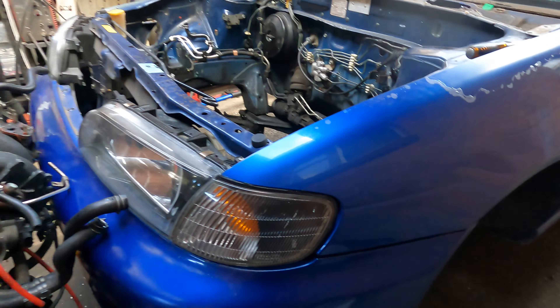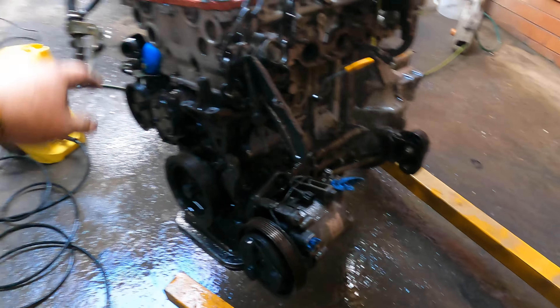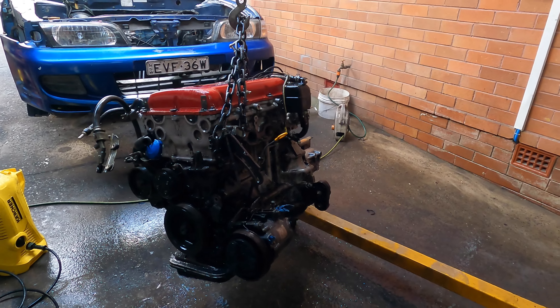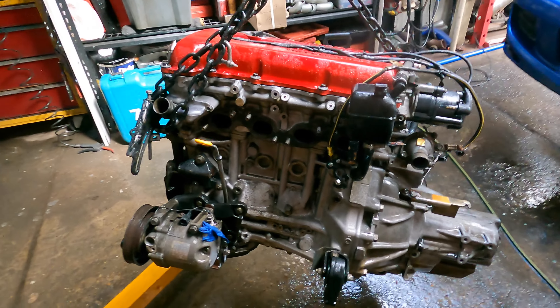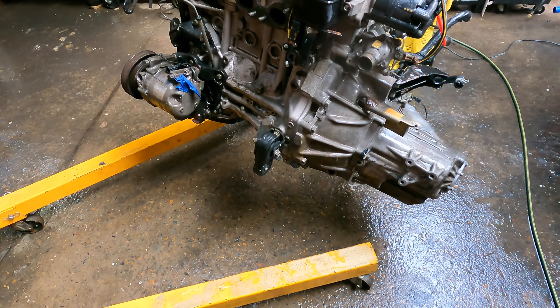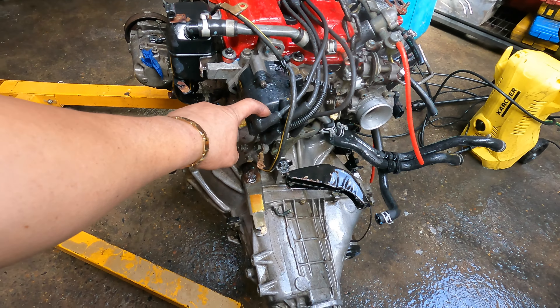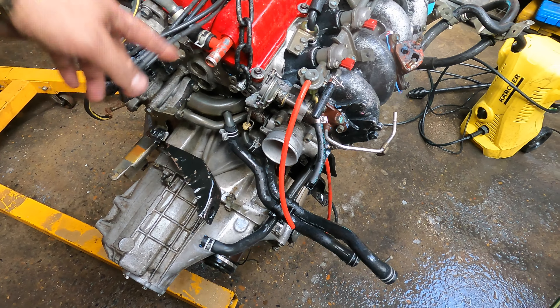Spray the degreaser on and then wash all the dirty grease off with the water jet. Before we strip the engine make sure it's nice and clean so we don't have too much dust or dirt on your hands. We'll leave it for the next day and strip it out. We'll order the gasket packs, make sure we take measurements and order the correct size of bearings and rings - just in case we buy the wrong ones. Maybe inside the engine it's been rebuilt or different size overbore - who knows. Okay guys, thanks for watching Simon2 - this is how Simon pulls out the SR20 engine from the Nissan Pulsar Q SSS.